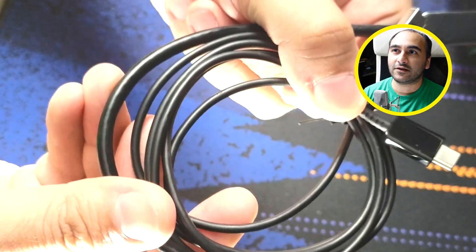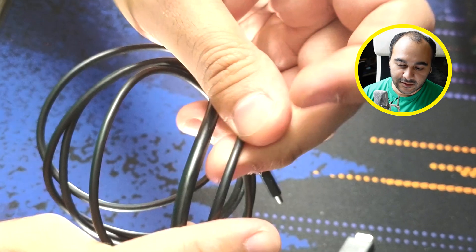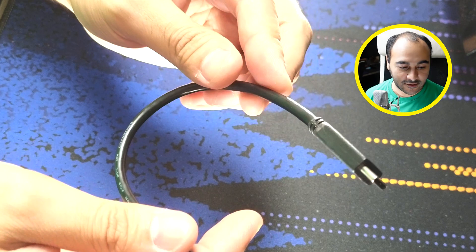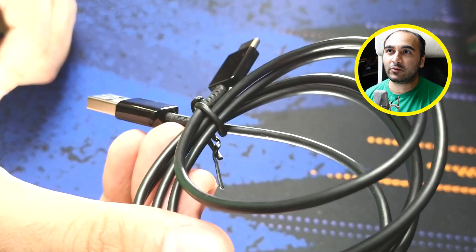You've got to see how different it is from the other cable — there's a thickness difference as well. You can even feel it when touching the wire. Look at this piece versus this piece — there's a big difference in thickness alone. But this one's short so it doesn't need to be as thick. If you want to use USB-C to USB-C at full bandwidth you're going to need a cable that supports it. This one does; the other one does not and will restrict your devices to USB 2.0 speeds.